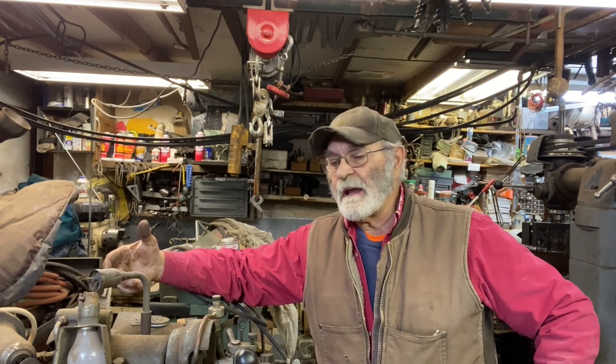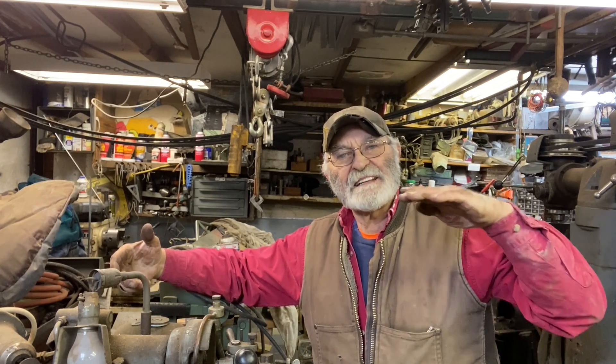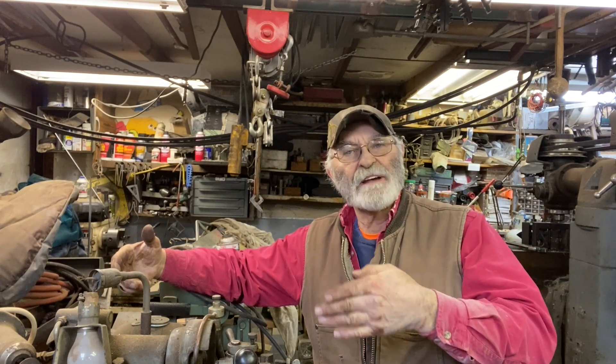He's putting everything together this week, and one of the valves is just entirely too long. Sometimes the tail ends of valves have to be adjusted a little bit. Sometimes you grind older valves and take a little too much off, making the top of the valve a little too thin. What happens is it sets down into your seat just a little too far, making your stem longer, so you have to address the stem a proper amount to compensate for that.